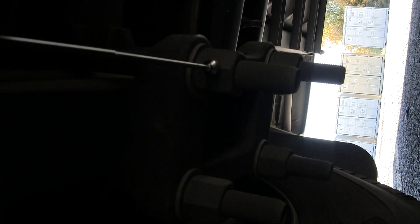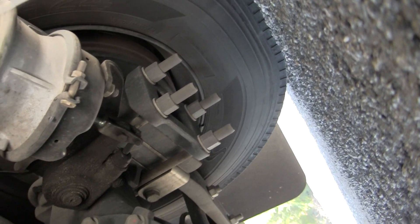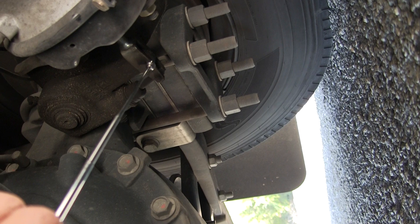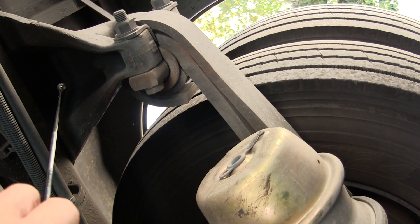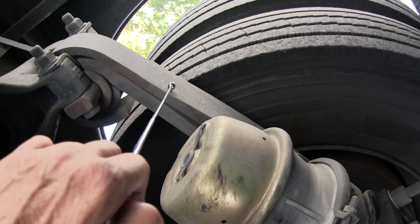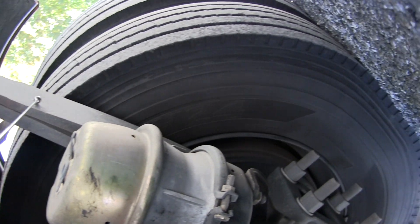I forgot to mention these — two U bolts, two nuts each per side. They're not cracked, damaged, security mounted. So we've got the U bolts, the brake chamber, the air hoses, the slack adjuster, and the push rod — that's your brake system. You have your control arm and control arm spring mount — not cracked, damaged, security mounted. That's the other control arm — not cracked, damaged, security mounted.